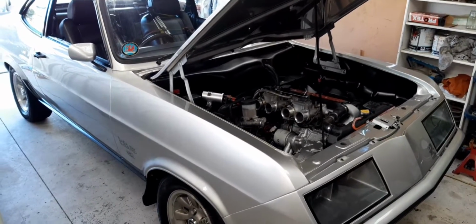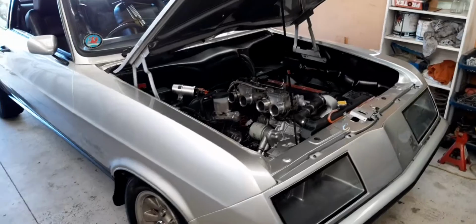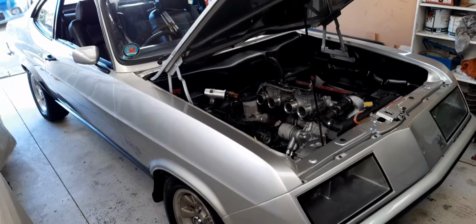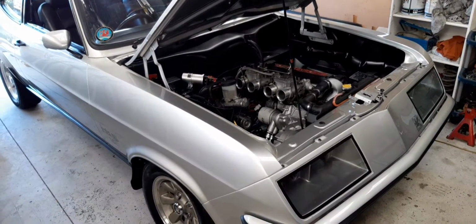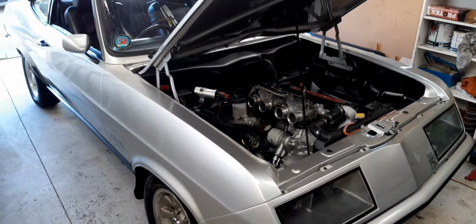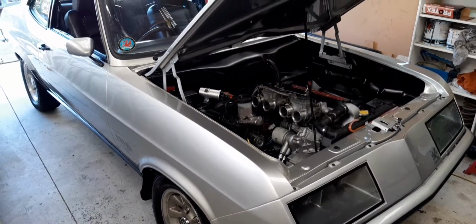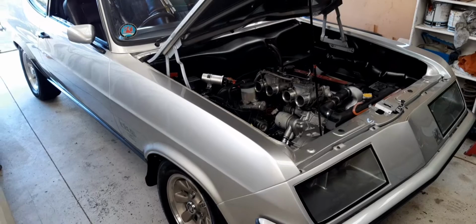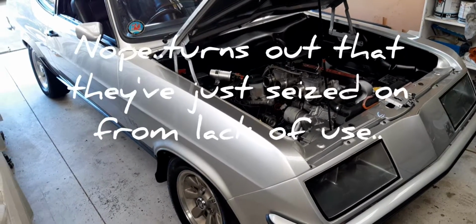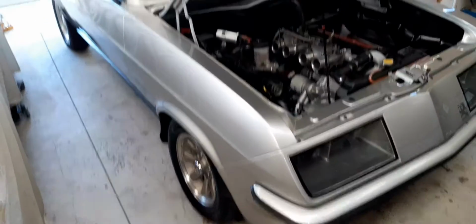So I've been for another drive, and there's no banging going on now, so that's good. The only thing is I need to have a look at the brakes. I'm going to get someone to help me bleed these a little bit more, the old-fashioned way, sitting in there with a foot down on the brake while I release the bleed nipple, and just make sure they're as good as they can be. It feels like the front two are sort of half jammed on, so I think I just need to release the pressure on those. I think the way I bled them, I did something a little bit wrong, which I know what it is, but I'm going to test my theory tomorrow. Sorry, I don't know why this is not focusing. Hopefully that should free up those two front wheels.